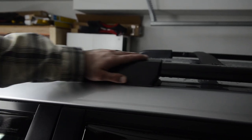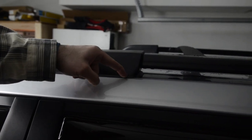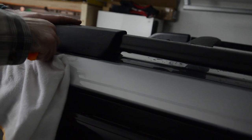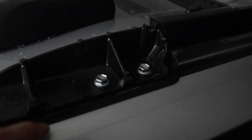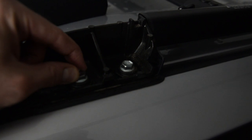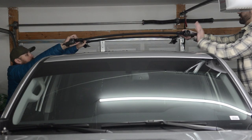So what we need to do on the OEM roof rack is pop off these caps — two in the front, two in the rear. Very simple to do: make sure you have a panel removal tool and we're going to slide it in between this rubber piece and the plastic piece, just pry it up and it should pop off — it essentially just has some clips. Use a rag just in case you miss so you don't mess up your roof. Once you have the cap off, all you need to do is remove these two bolts — you're going to have two on each side on the front and two on the rear, then the roof rack will just come right off. Once we remove this, we're going to go through, clean everything up, put the Cali-Raised slash ProBuild rack into place, make sure it's all looking good, throw some silicone down, reuse the OEM hardware, and just tighten down all the little T-nuts. I've got all the bolts out — next up, we're going to pull this rack up and go forward with it.